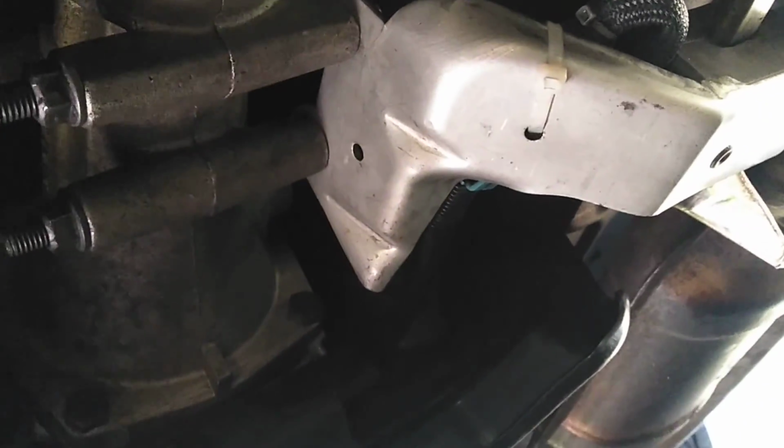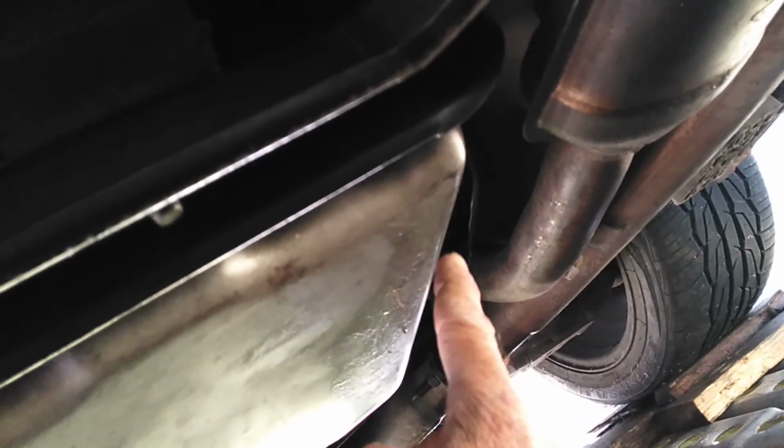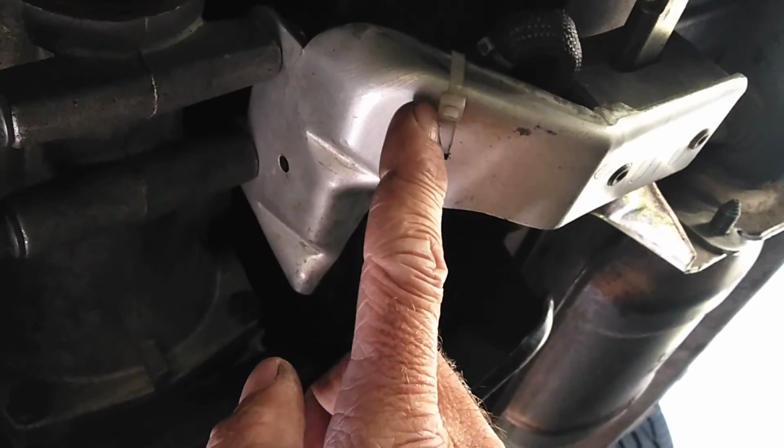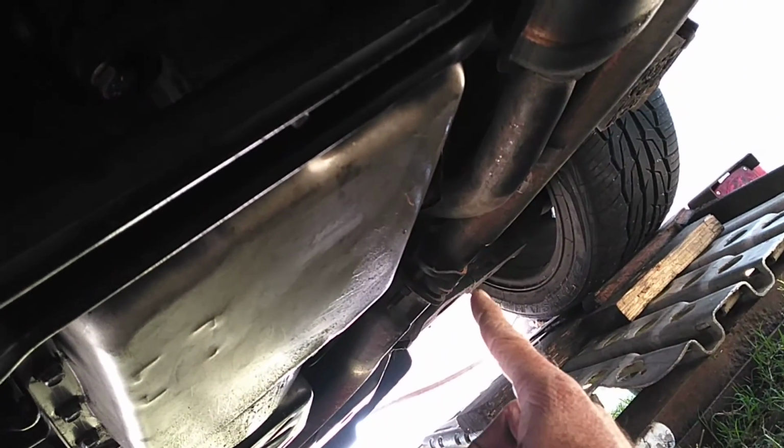The quick disconnects up there, I've tightened all that and straightened that out. Let me go back here. Everything's buttoned up. I've pulled this. This is to the O2 and the harness goes up along there up by the exhaust. There's a little heat shield. Well, if you pull this harness back, you can pull the harness further away from the header and zip tie it here so you've got no slop up there in front by the motor area. So this is something I do.